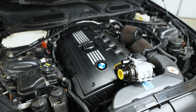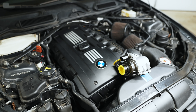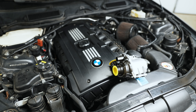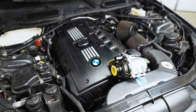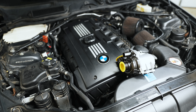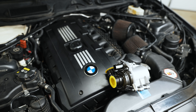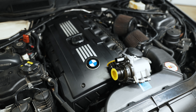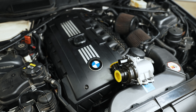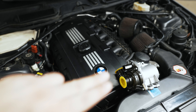If they made the N54 water pump twice as powerful, they knew there'd be more heat due to the turbos, so they had to overrate it. But I don't think they ever anticipated people pushing them to double the power. If they knew this car would eventually be making over 500 horsepower in the hands of enthusiasts, it probably wouldn't have had an electronic water pump — a mechanical pump would be more appropriate because it can keep up with demand at high RPMs and heavy loads.